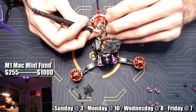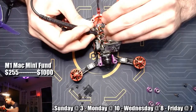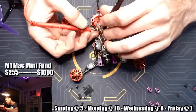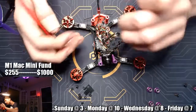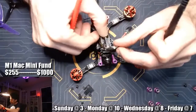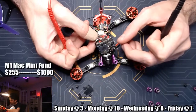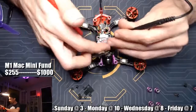Interesting. Let me just make absolutely sure. Well, this is odd. Just want to make sure that I was on the pads. Huh. Well, this is a little weird. Okay. What else could be going on here? I guess there's a chance that when I plugged the cable into the ESC, I bent the pins, and maybe the pins are touching. That's a possibility.